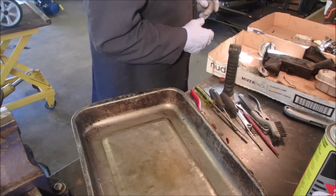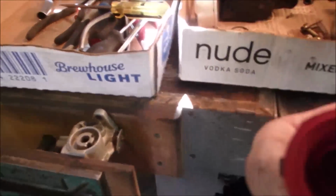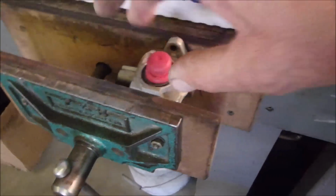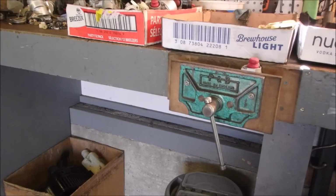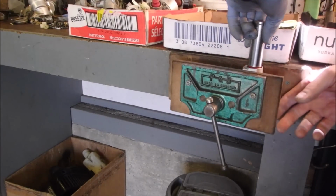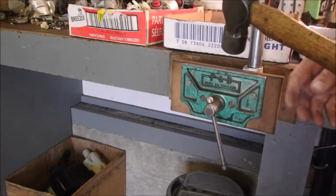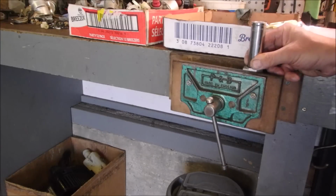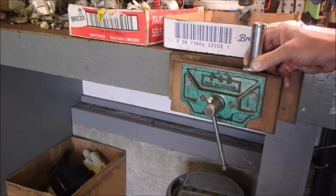Okay, is it clean? Okay, I'm putting a new primer bulb on here. I've got the ring on that comes with the unit. Here's your number, 36045A. And then once you get it all lined up, and I've got a nice little vise here with no teeth, it's a wooden vise, I just put the 18mm socket on there. And I'm sure there's other sockets you can use if you don't have millimeter. And then I just tap this on. And I kind of rotate it like that. First I give it a square tap. And then I rotate it around.